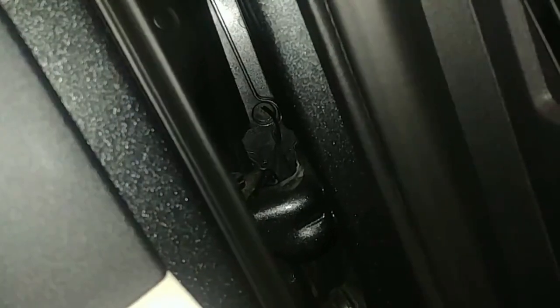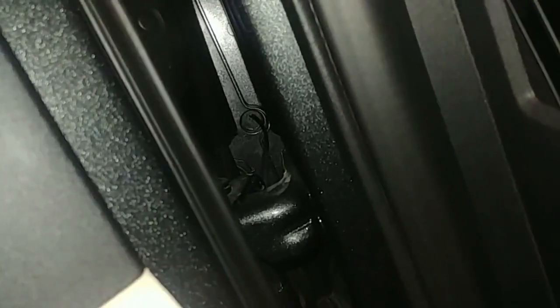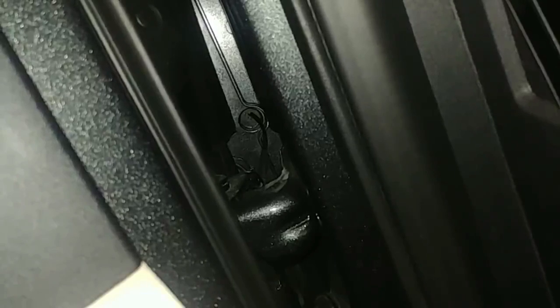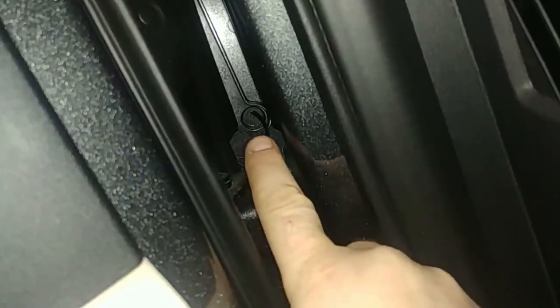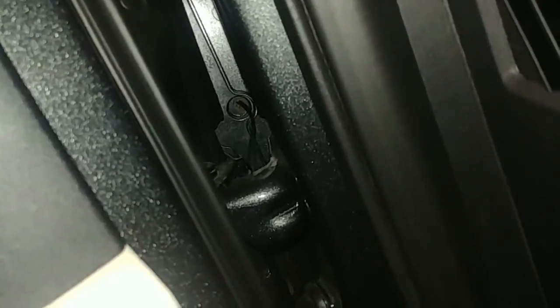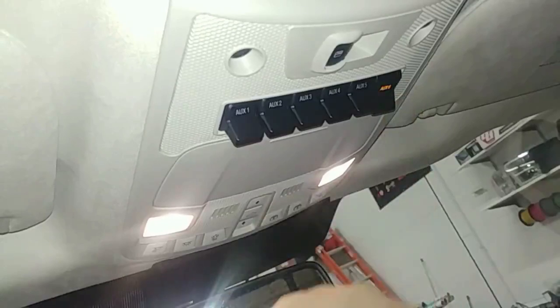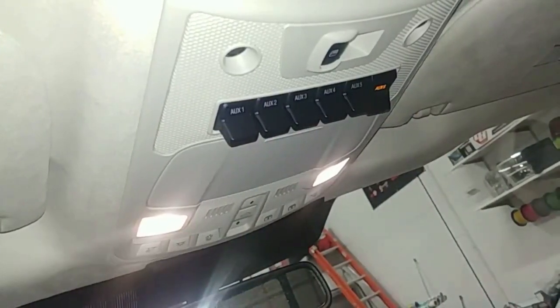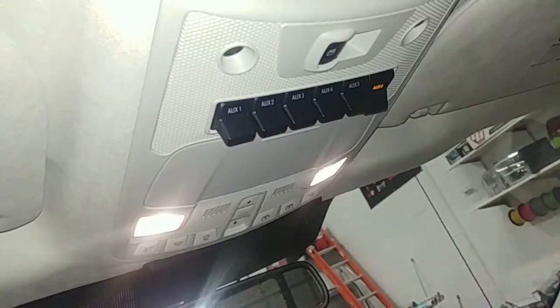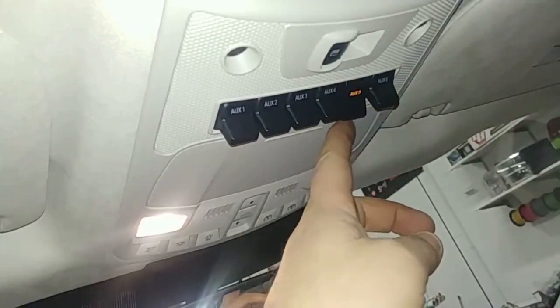As you can see right there in the door jamb, that dime-sized circular indentation is a plastic bulkhead. You're going to want to reach in from the engine side and pull back some of that foam insulation and drill a little hole right through that plastic dime-size right there. Once the badge is removed, you can reach your hand around and run the wire through there, and it comes out on the inner fender well right underneath the hood — easy to hook up to your auxiliary switches. Those auxiliary switches right there — that's the very same one we're hooked up to here on number six. We've also moved the fuse to make that switch work with or without the key. That modification only works on five and six.